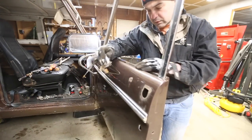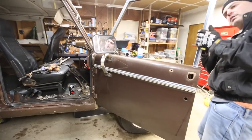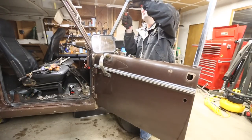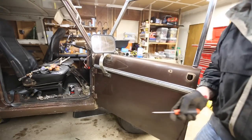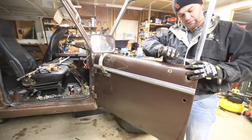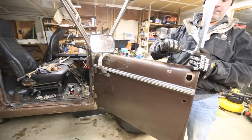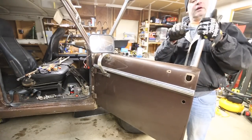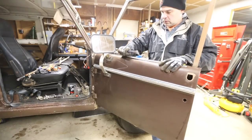For the Ranger trim, there are a couple tabs — one up top. It'd be awesome if it just pulled straight up, but there are two tabs that snap off. You just kind of have to get it started and then gently move it up the trim. It'll end up with a bow in it — there's no way to avoid that. Once you get it started you can kind of work it out with your hand.